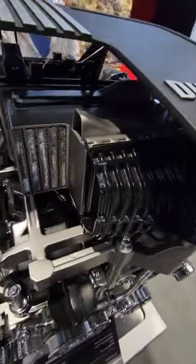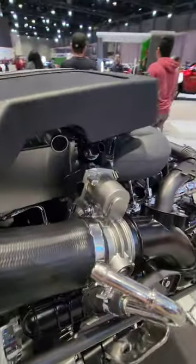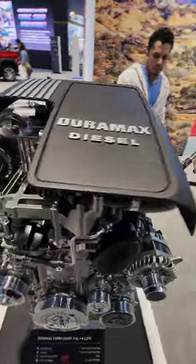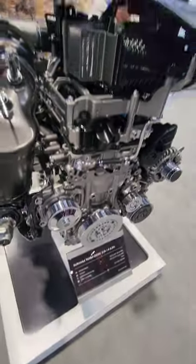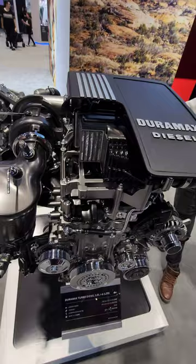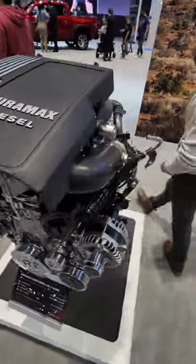Here's your heat exchanger — it's a water-cooled unit that would connect right over here. Normally you wouldn't think this is a good place for the heat exchanger because all the heat in the engine rises up, but because it is water-cooled it still stays cool. And it's the shortest path directly into the combustion chamber, resulting in less turbo lag.